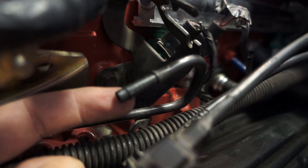Make sure you unplug this hose from the fuel line — it comes out of this plastic part right here and plugs into that. You're going to want to disconnect your fuel lines back there. The plastic tool is easier, but all I have is the metal one.